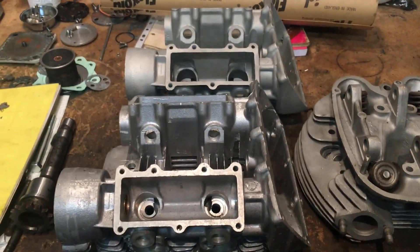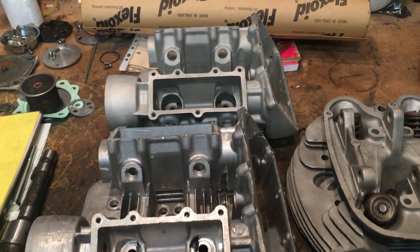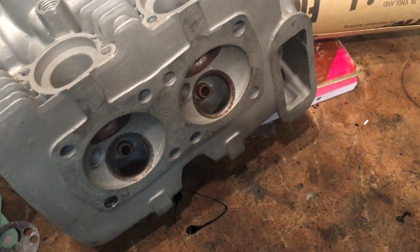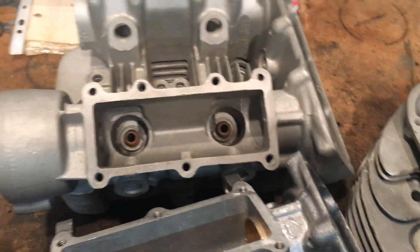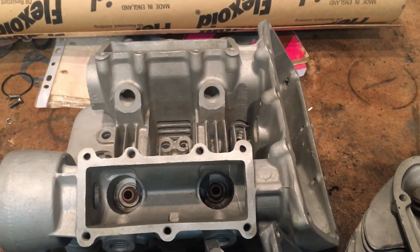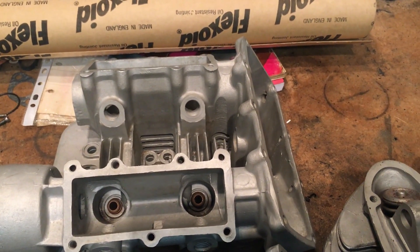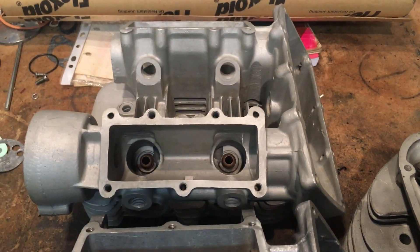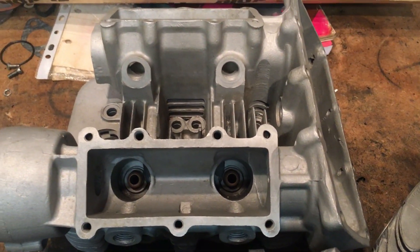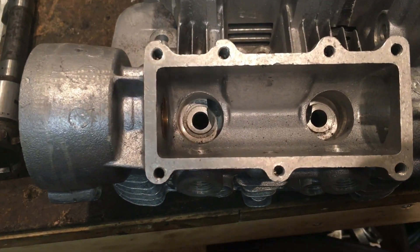The main purpose of this video is that a friend and collaborator has kindly lent me his Fury head, because this is complete with valve seats and also has had all the machining completed. As you can see, his valve guides are inserted too, as it was from a complete motor before it was damaged. He's in the process of building this Fury up but isn't at the stage of building up the engine yet, so he's kindly lent me the head so we can take measurements off it with respect to the tappet bores, the valve guide bores, and the valve seats.